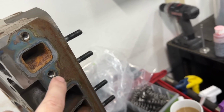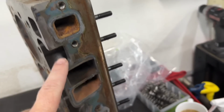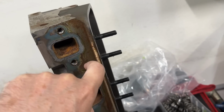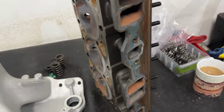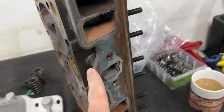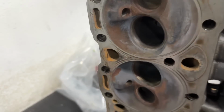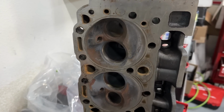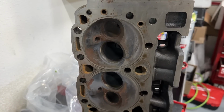You could get the standard pattern or the Vortec pattern manifold. And before you go, well, that's a clear indication that it's not a Vortec pattern because of these bolt holes, several of the Vortec heads we actually drilled like this so they could take a conventional manifold. So this head's really kind of cool in that way. Now it does have an exhaust crossover, which no Vortec ever had. But it won a lot of races, and then for probably 3 years, this was the ticket, and then all the tracks here said no, they're illegal.